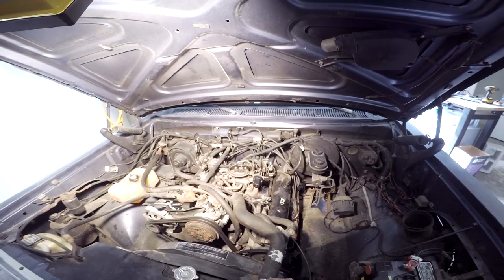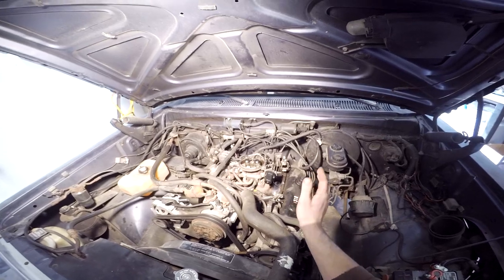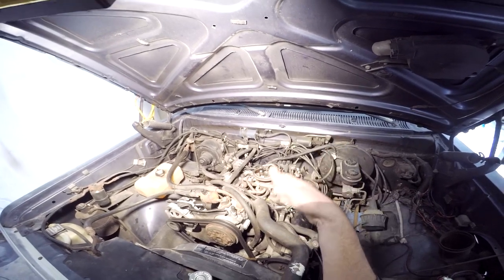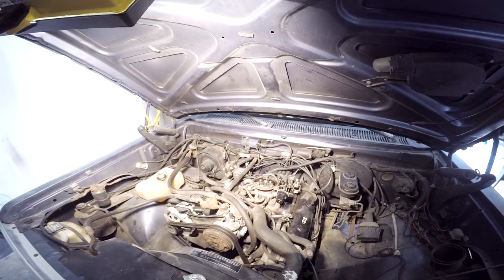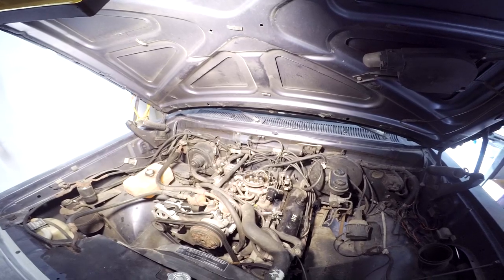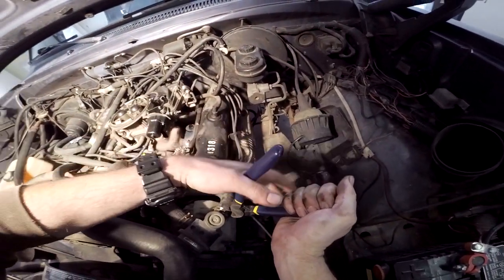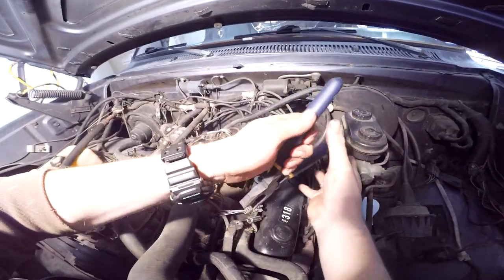You might as well do it while you're here, yanking off this hose, which we're about to do, and this one, and plugging it. So that's what we're gonna start doing now, by getting these hoses out of our way. Then we're gonna chop up the exhaust into several sections, so that I could salvage the new stuff I put on, since I own the vehicle, and get it all situated. So let's start by doing this all now. With the handy dandy pair of pliers, go ahead and get these constant pressure clips off and not drop your pliers into the engine bay.